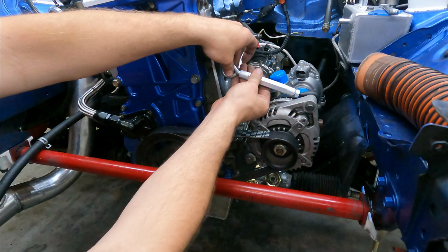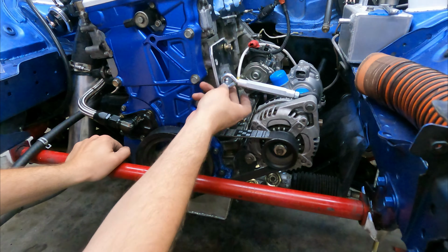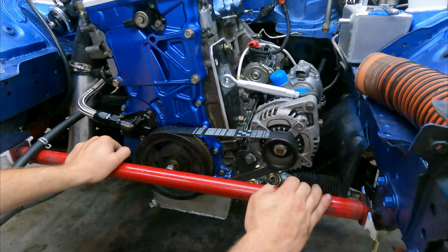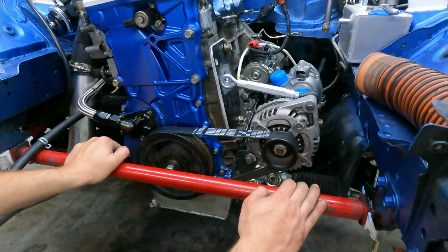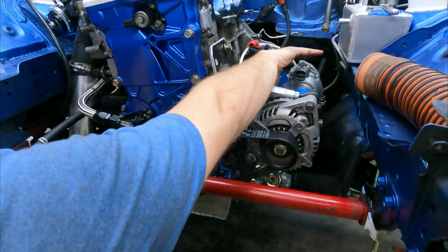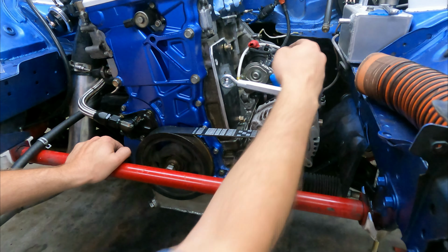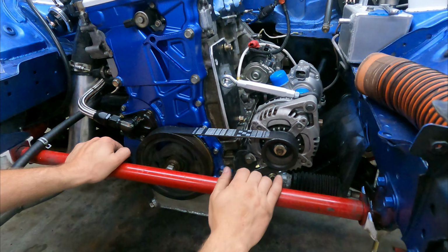So I'll have all my tension adjustment through that rod right there. I'll just weld a tab to here to capture the hook, so that's secure. And then that tells me exactly how much room I have to mount the water pump back, probably right about here is what I'm thinking. And then run cooling hoses out here to the radiator and then into here to the block.